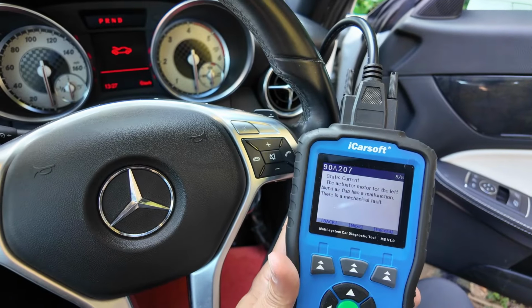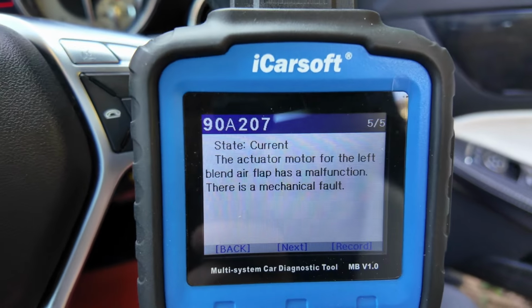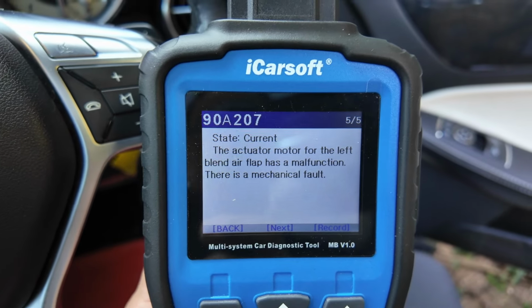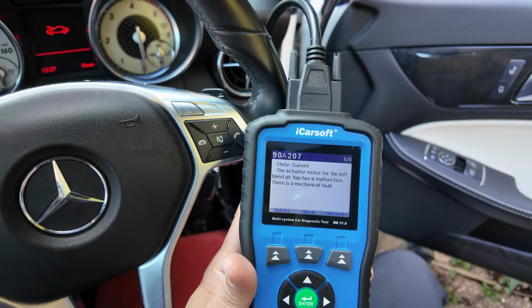So just plugged in the diagnostics into my subscriber's SLK. Lo and behold, there you go. Blend flap mechanical fault. The same fault code as I had in my car. So I'm 95% sure it's the same issue, seized blend flaps. Let's get to work.